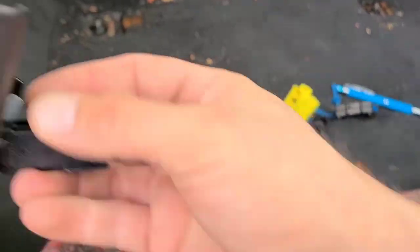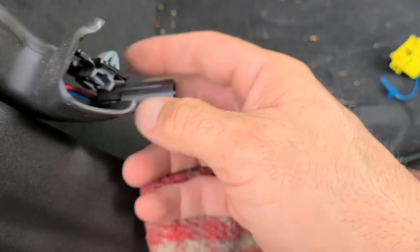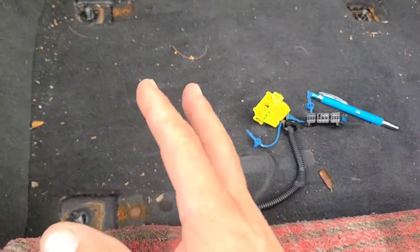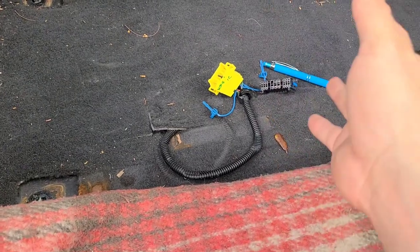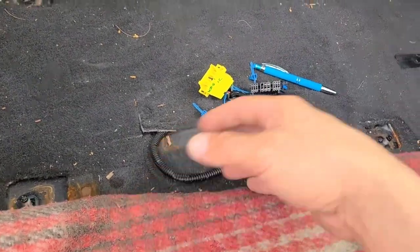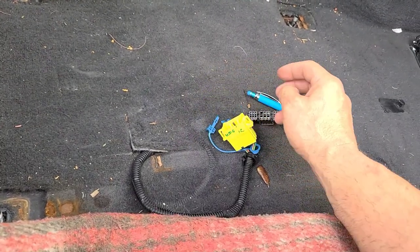The seat belt itself has a little plug and it's held in with another 15 millimeter bolt. So with five 15 millimeter bolts, you've got the seat undone. I disconnected the battery — I'm usually kind of hardheaded about that, but I don't want the thing exploding on me. Since you're touching yellow airbag stuff, I did that.